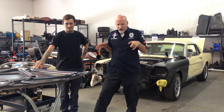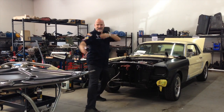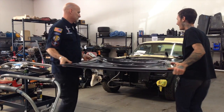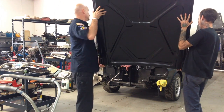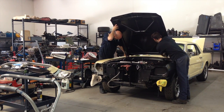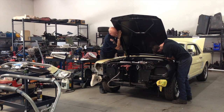I digress. Here we go, putting a hood on a '66. This hood is much lighter than the '71–'73 Mach 1. We're going to do the bottom bolts first, because the bottom is what's holding the weight on the car. You set the bottoms first, then you do the tops. I'm trying to hold it as close as I can to the hole so Sky can line it up and get it threaded — and he's got it threaded.